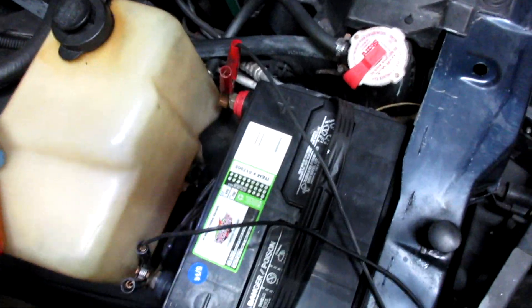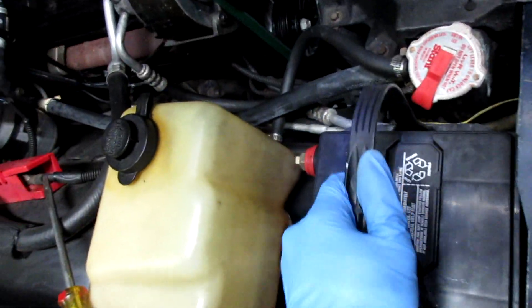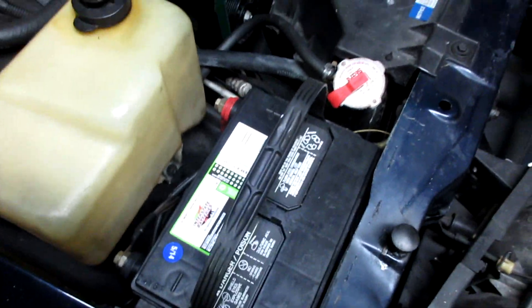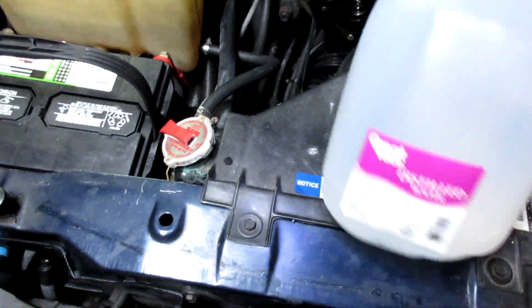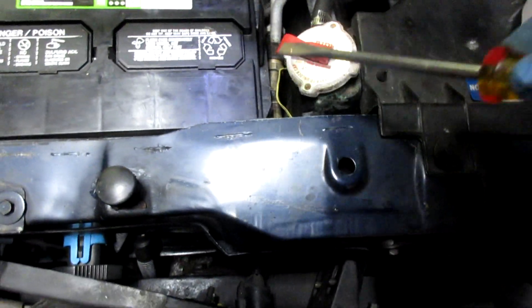I have this battery here. It's kind of old. I'm going to be checking the water inside of it — perhaps I can get a little more performance out of it. The battery goes low on water just over time; it just evaporates. It's a mix of sulfuric acid and distilled water. It's probably distilled water, probably from Walmart — about a dollar or less.